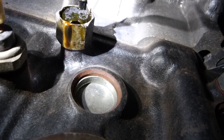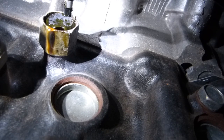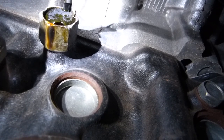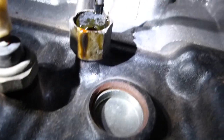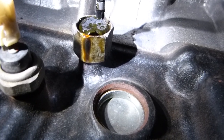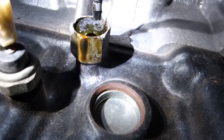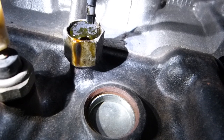As well as, if the belt gets frayed or gets loose or something — there's the belt here, barely visible. Or, if the engine oil level is low enough, the engine vibrates differently than with oil within the normal range. That could trigger a knock sensor code. As well as, of course, if you just take out one of the spark plugs, then the cylinder from which the spark plug is removed is not going to be firing. It's going to register as lack of normal vibration on the knock sensor and on the computer.